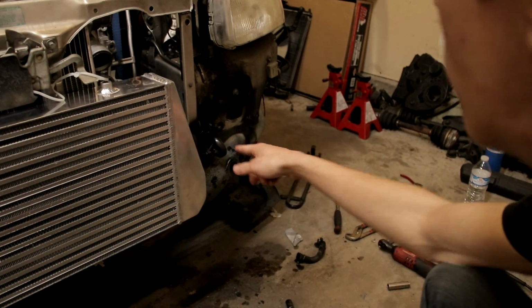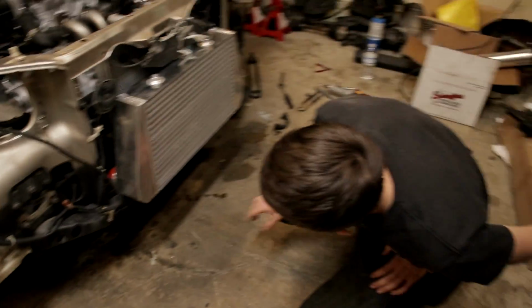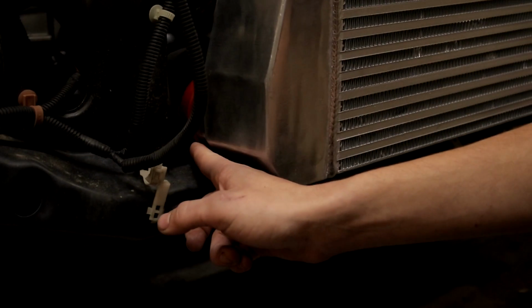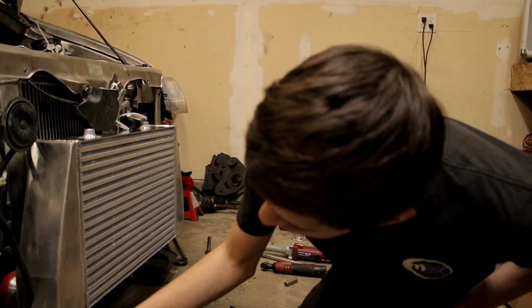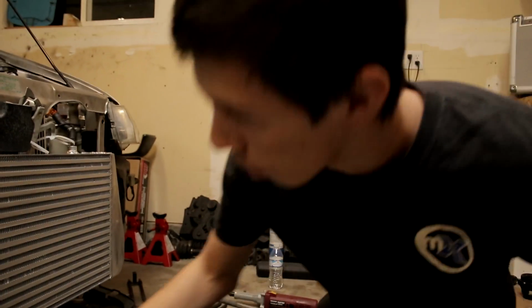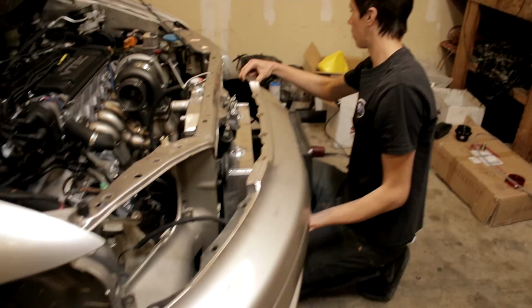We also took the power steering cooler all the way off, so we just have it looped around right there for now, so we can test fit the bumper because we haven't tried that yet. But I'm liking how that fits. I think we're gonna have to trim it a little bit down here because I would like the intercooler to come up a tad so we can get the couplers on a little easier because it does sit really close. But because of this latch being here, we're not gonna be able to go up hardly at all. But there's this little lip of metal that I think we're just gonna trim out and then we'll be good. So then we'll probably just make some tabs coming off this bottom piece and that should be really straightforward.